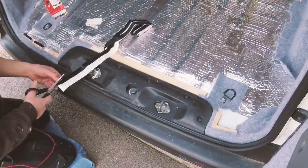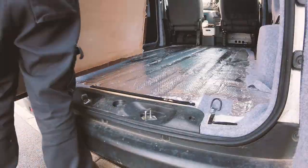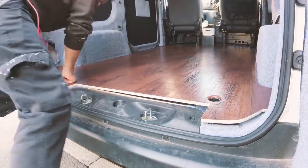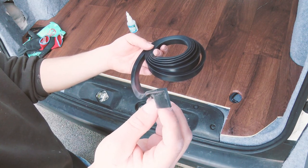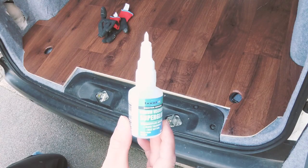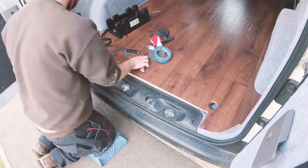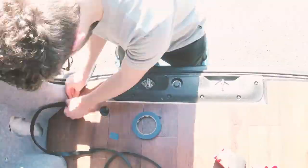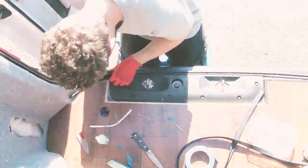Moving back to the back door edge, off camera I neatly trim the vinyl to the edge of the plywood, and use velcro to help the end of the plywood stay flat, whilst enabling the floor to be removed easily if necessary. After this, I replaced the floor and used my own weight to get the velcro to stick to the plywood. Finally, I was able to complete the back door edge of the floor. I am using lengths of rubber L-section to finish my edge off, which isn't the most common of edging materials, however I wanted something flexible to work with the curves on the back edge. I then abraded the inside of the rubber to help adhesion. I used Bondit medium viscosity cyanoacrylate glue, which was specifically meant for EPDM rubber such as this. I set about taping the rubber to the vinyl so I could cut a border out of the vinyl, glue the rubber in place and end up with a level edge between the rubber and the vinyl. Being a doorway, I wanted to ensure that the rubber didn't get kicked or knocked off, and this seemed the best way to achieve this. I worked my way along the back door edge until it was all covered with rubber, and with that, the floor was complete.